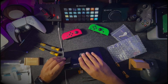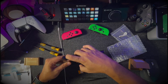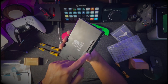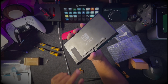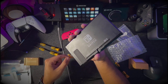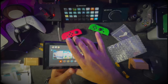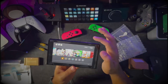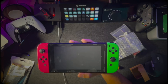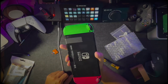Let's give this a test run. Let's go ahead and slide the SD card back in. If you're just joining, what we did was we took the screws out of the switch — just the case — left the metal plate, and swapped out the broken SD card reader. You'll see the error we were getting at the beginning of the video. It is so easy to just replace your SD card reader. I am so happy my son can now play his Nintendo Switch again — the games are reading, it's detecting it. We have successfully replaced the SD card reader.